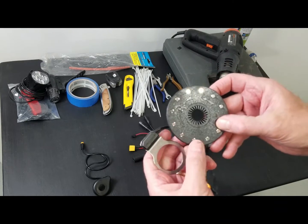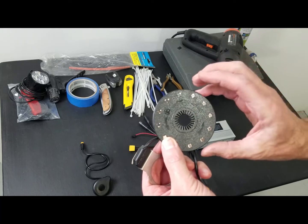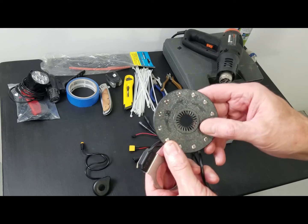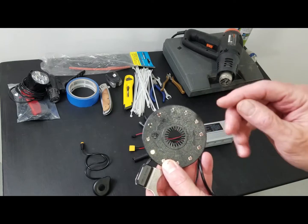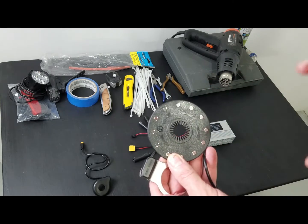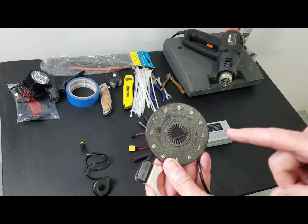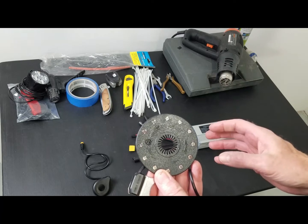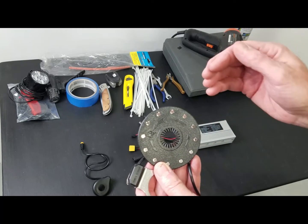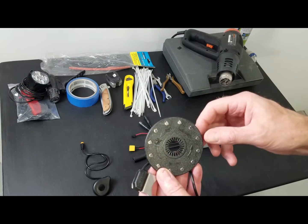These things can come in different styles. This one has a bunch of magnets, which allows a little bit more functionality on the cadence sensor itself. With this, you can program things to slowly ramp up the power on your bike, or if you're pedaling really fast, it will actually reduce the power — because when you're going really fast, you don't need a lot of power being applied.